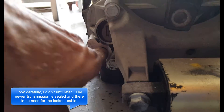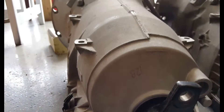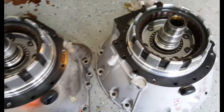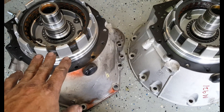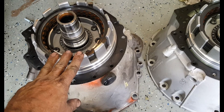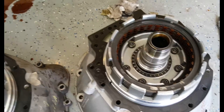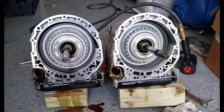Even though I'm going to install the transmission, it won't be too drivable until I have a means of pressing that in there. And then I'll have to swap out the bell housing. So here we have it — bell housings off. This is the 608, this is the 636. Given the age of these things, I'm going to take this pump and put it on the 606 bell housing. Actually, this is a 722-608 that was on the 606 engine. I'm going to use this bell housing but take this pump off the 636 transmission. The clutches should be newer — it's a 2002 versus a 98.